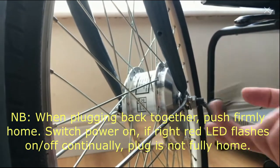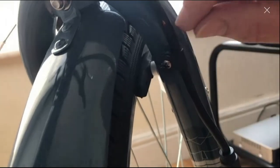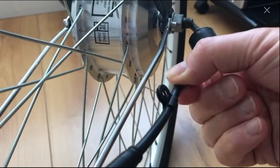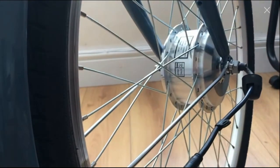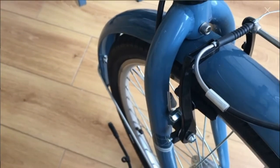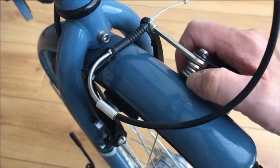I've discovered this clip is broken. That's nothing we've done because the bike's been under no pressure whatsoever. And the screw is loose as well. So I might use some kind of washer there to help with this when I fit the thing back again later. Not very happy with that. That of course is what the clip should look like. So what we'll do now is turn the bike upside down and take the wheel off. I need to slacken this off a little bit to get that out — this is an allen screw, so there's nothing at the back of it that needs to be held. We're using a proper allen key, which in this case is a five millimetre.